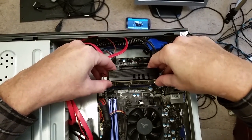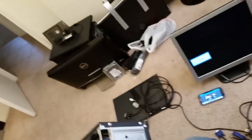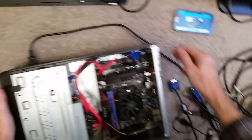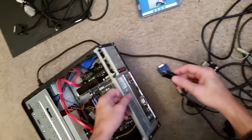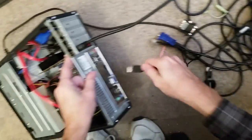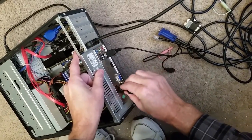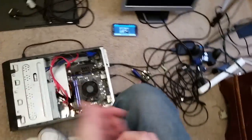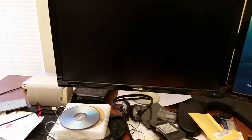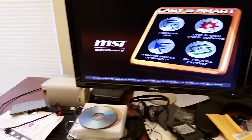I'm going to drop this in — just like that. There's nothing really holding it in place, it's just kind of flopping, but just as a quick test to see if this is going to work, that's fine. I need an HDMI cable, and I'm going to hold on to the video card with my finger as I put it in. Let's go ahead and give it a keyboard and mouse connection and turn it back on. Got a little blue activity light and looks like the BIOS.